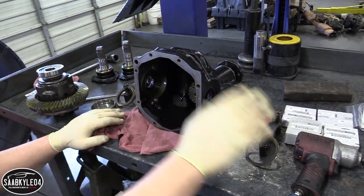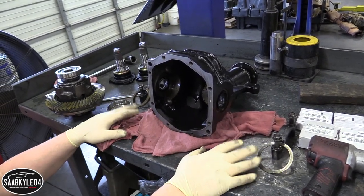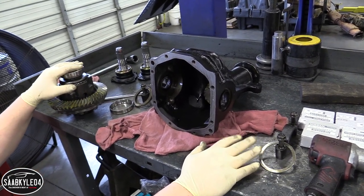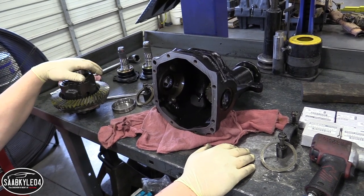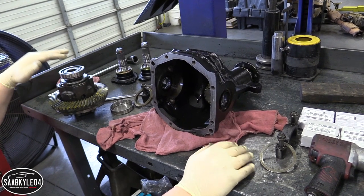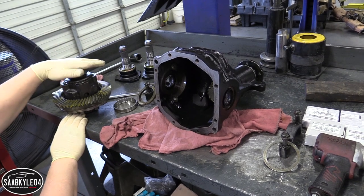Keep your left and right separate so that you can put the shims on the bolt and keep track of them — that's going to be your next common mistake. Now if you're changing this carrier, which you did change, there may be some adjustment that needs to be done to get the preload and the backlash just perfect, because the stack height and the machined height of it may be different.